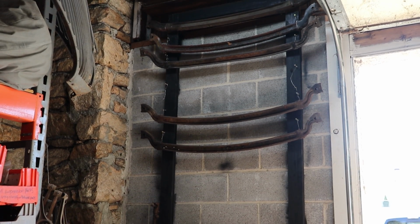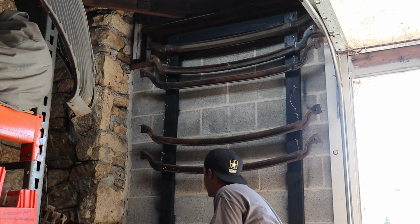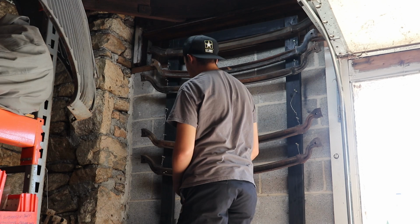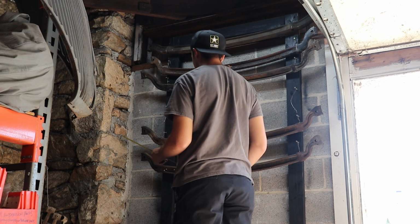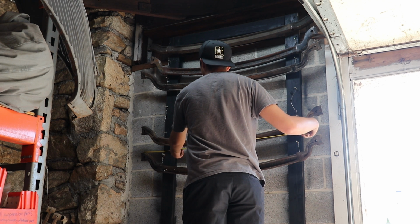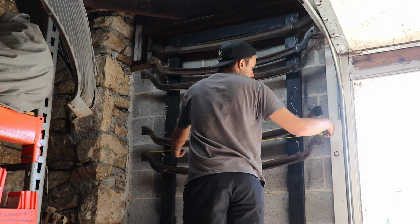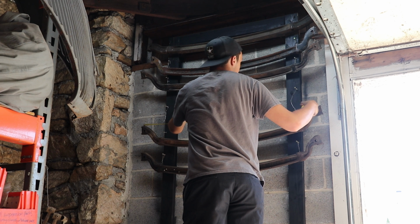So Andrew's going to climb up there and we're going to donate an axle to him. We're going to try and find the most narrow axle we can up here, since he's doing this '60s style build. They usually have the real narrow axles in the front for the style he's going. So what are the bottom two, center of kingpin to center of kingpin? This one is 48 inches.